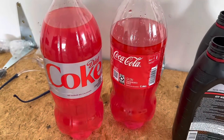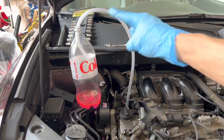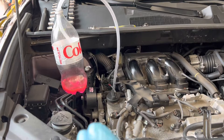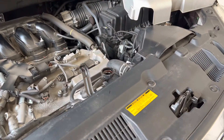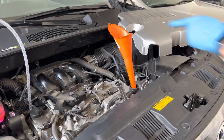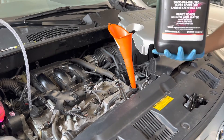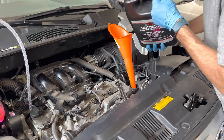This is how I have put the tubing in this empty bottle so that if there is any overflow it comes in here. This will work when the engine is started and warmed up. Right now I'm just going to do a cold fill. To avoid spilling, I'm going to use this funnel and go slow. This is a new can of Toyota super long life coolant - it is pre-mixed.